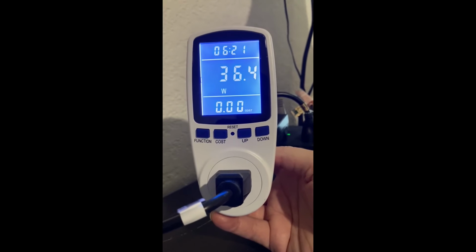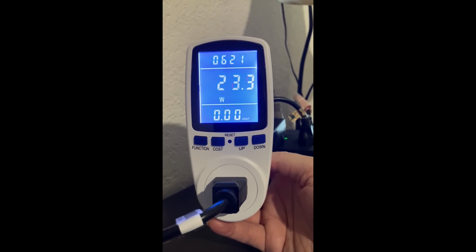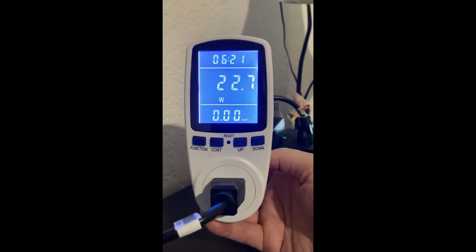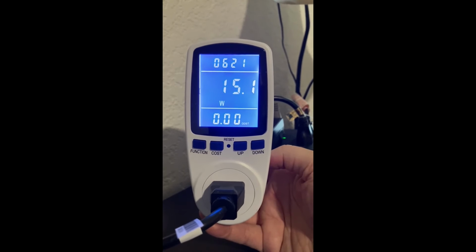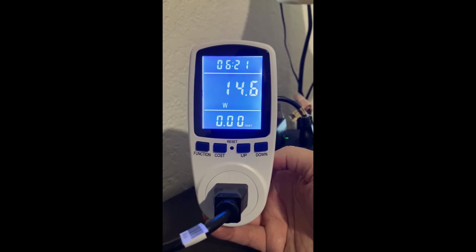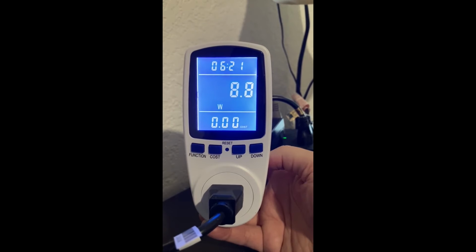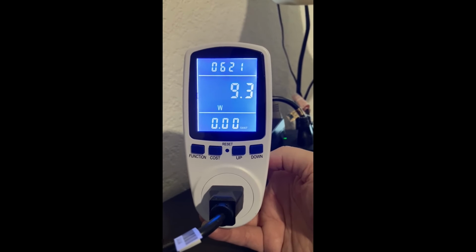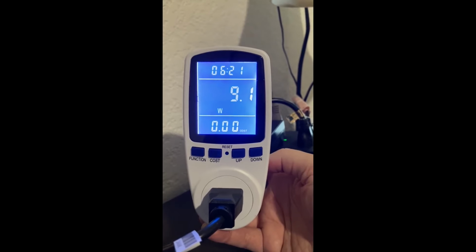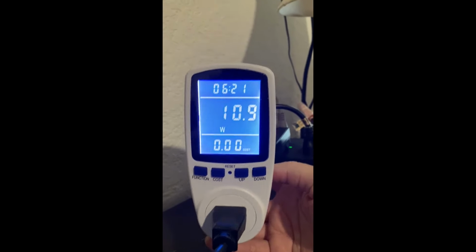So definitely it's odd. All right, Steam has started up. It loaded up a few things. That's where you saw it go up to about 40 watts. And so now Steam is running. I'm not running a game yet, but you can see it's settling around 14 or 15 watts. So it's probably utilizing the GPU a little bit, just sitting there, but you can see it's moving down slowly. So it may be preloading some things to make the games load a little faster. I'm not sure how it all works, but there you can see it's starting to settle down to around 9 or 8 watts.